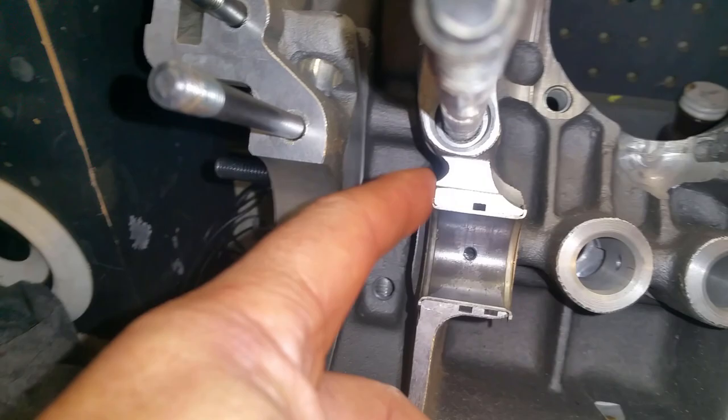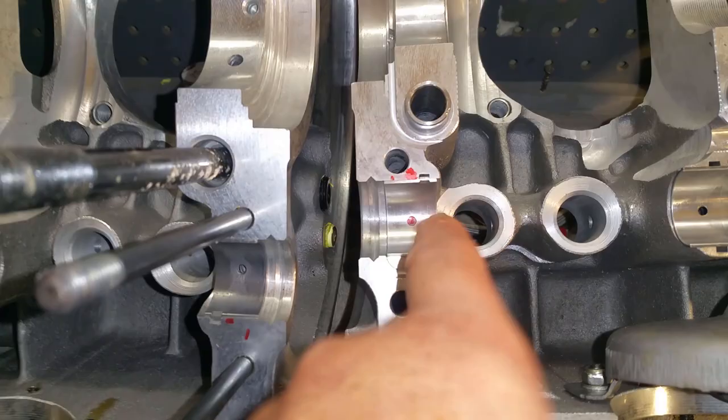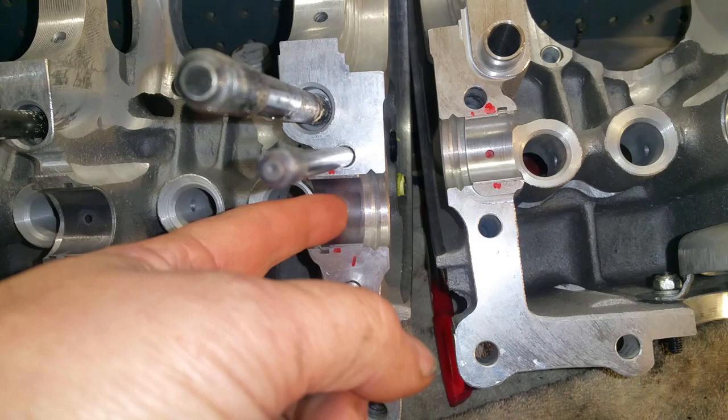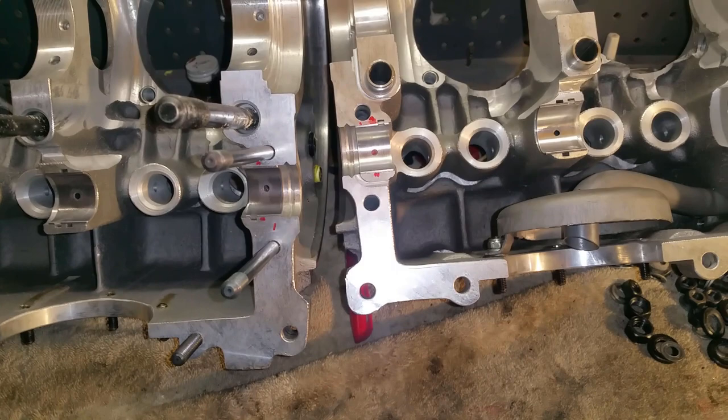This side is still there but this one's gone. That's the reason I'm drilling this way and then that way — it'll pressurize this bearing, more oil, less wear. I'm also going to pressurize this one. I'm just going to make a groove that goes around like that, and another groove right here, basically sending pressure through the back to this bearing. I'll show you the end product.